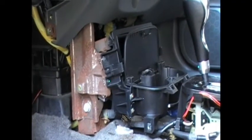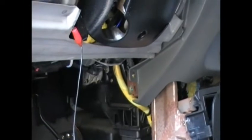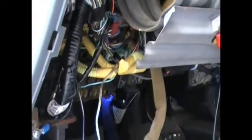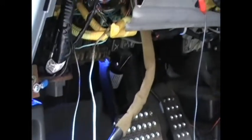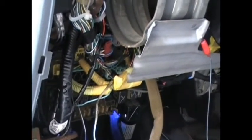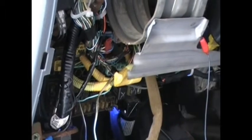Here we go — there's my cup holder installed. I have the wires from the LEDs running underneath and up under there. You can see the wire hanging down right there — I just need to zip tie that up. It runs across here, zip tied over here a little bit, then comes down to there. I already have a spade connector from the fuse box with constant 12-volt power running right there so that I can hook that to my switch. Make sure you're careful when you're working in your fuse box that you don't unplug any of those important harnesses on accident — make sure you press them back in before you close and button everything up.